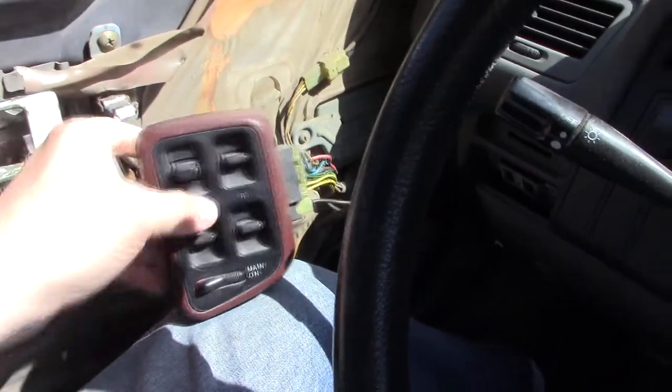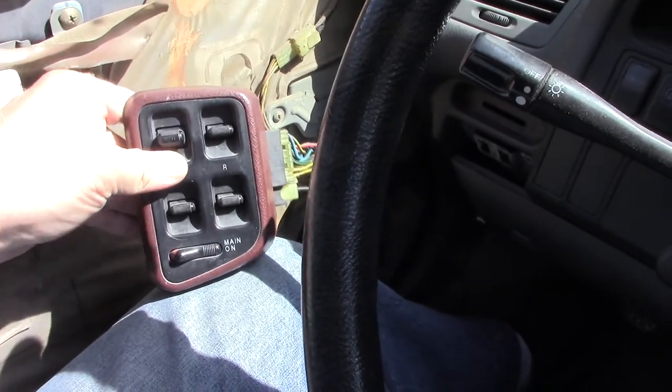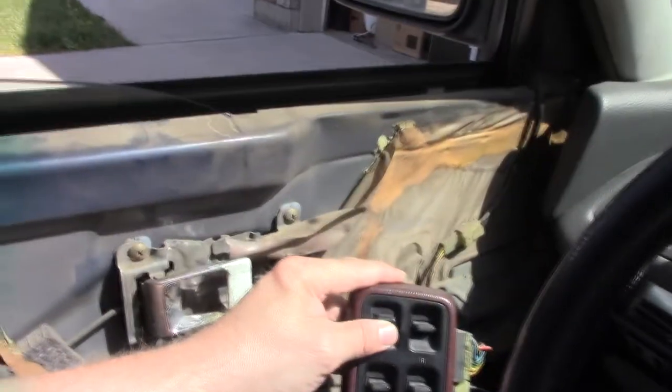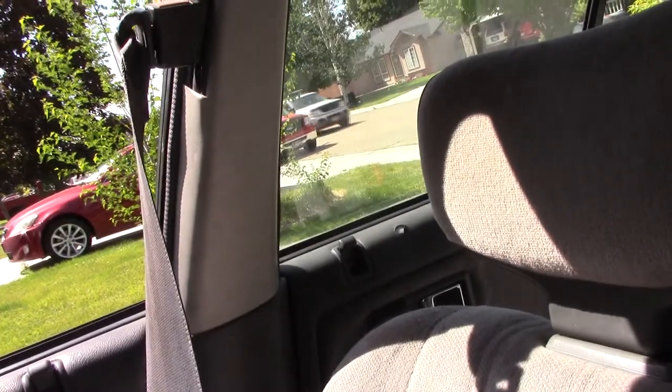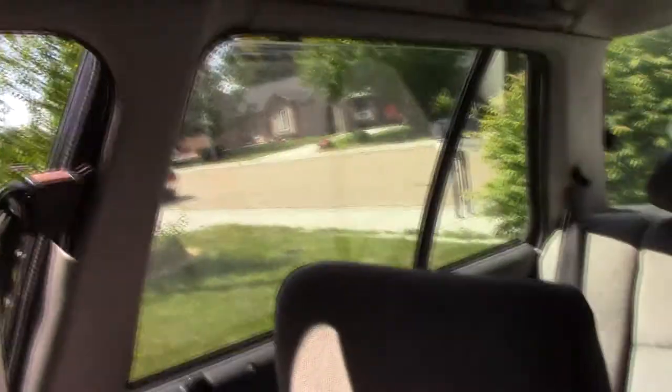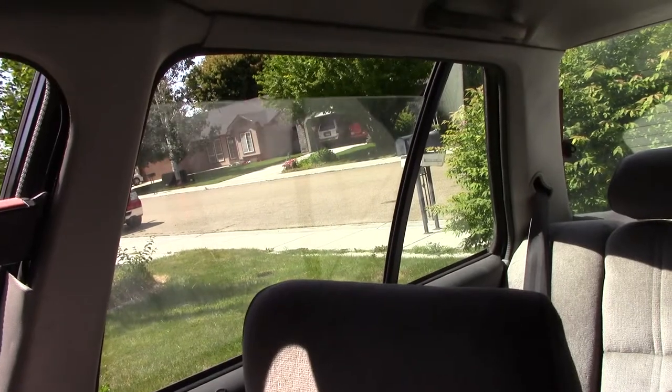Let me show you what's going on here. I went and picked up another main switch from the junkyard this morning just to see if it was that, and I'm having the same symptoms. So I know it's not any of the switches, and I've replaced the two rear ones. The front one goes up and down just fine on the driver's side. Passenger works just fine as well, but the rear one does nothing. Same thing with the other rear — but if I open the driver's door, this one goes up and down and I still get nothing from the back one.